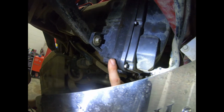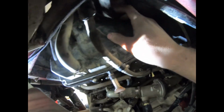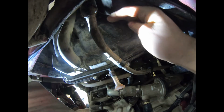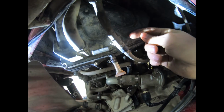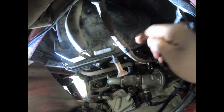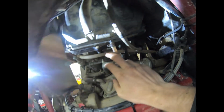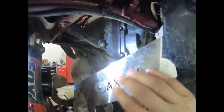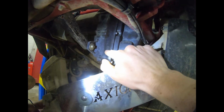So these Venturis come out and they are really close to this lid. The problem is the air's got this nice smooth area here, and then has to make almost a 90-degree turn into the Venturis that go into your throttle bodies. Now what Alba has done, and it's been proven, is that this actually adds horsepower.